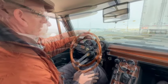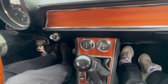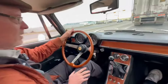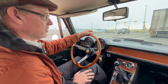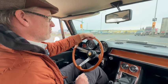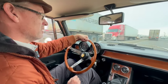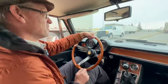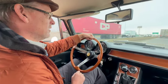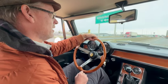1,500 RPM. So now we're up to 160 Fahrenheit on the water temperature, and the oil pressure's settling at about 40. It's a cold day. You'd expect the oil pressure to go down to 20 PSI or so at idle. There's no resonance or rattling from the engine. On some of these cars, other noises enter the cabin and detract from the overall experience, as opposed to just the induction and the exhaust noise. On this car, I don't hear any of that.